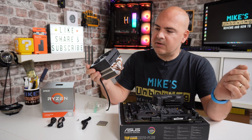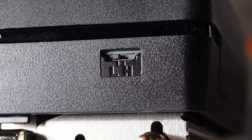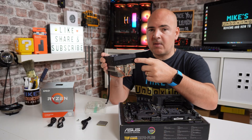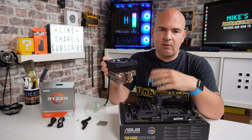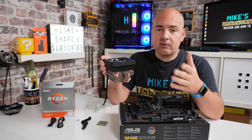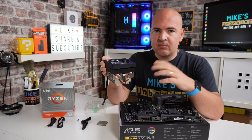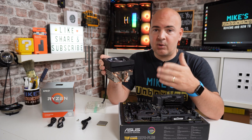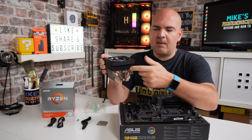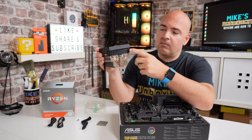On the cooler there's a low and high switch in this corner for fan speed. In low mode it goes from 0 RPM up to around 2700. In high mode it gives a turbo boost up to around 3700 RPM, which may get a little noisy but will make things cooler. Depending on your processor, your best bet is to try it in low mode first — which is the factory default — and if temperatures get out of control, flip the switch to high and adjust your fan settings.